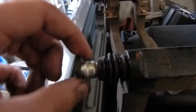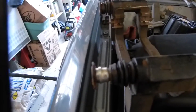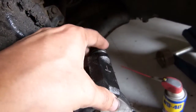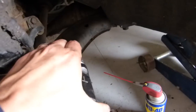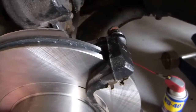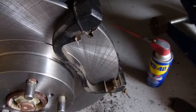This end of the boot slides up over the lip that's machined in the pin and keeps everything sealed and free of dirt and water. Got the caliper bracket back in with the pins and boots mounted properly now. The more I think about this, the more I'm convinced that the garage that had done this work just screwed these boots up. I was probably getting some uneven pressure on the calipers, and that's probably what caused my rotors to warp. Hopefully this will solve the problem and I won't warp these new ones.